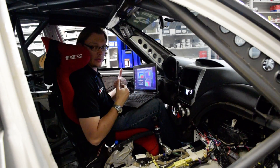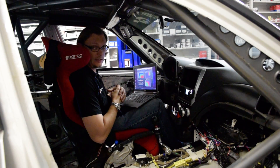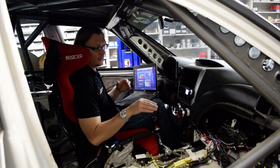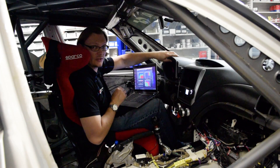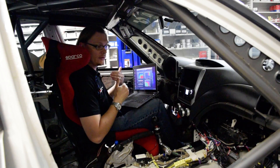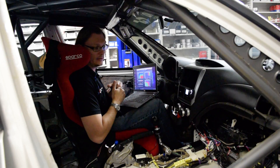This is a '14 — it's a CAN bus car. So getting the engine RPM and the vehicle speed were actually a bit tricky, because those signals do not go directly to the ECU; they actually go directly to the cluster. What we discovered is that you can actually tap into them coming right off of the cluster — it's pretty straightforward. On the older cars, the GDs, all that information comes off of the ECU.